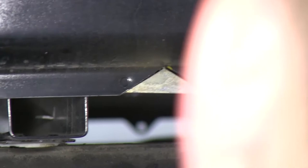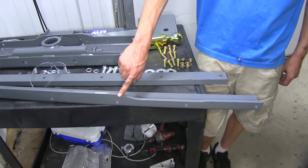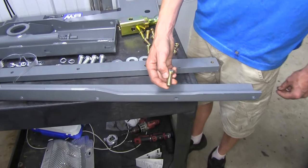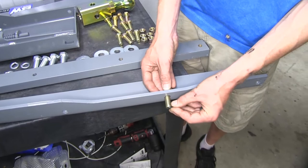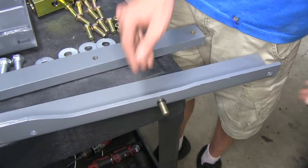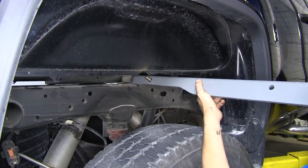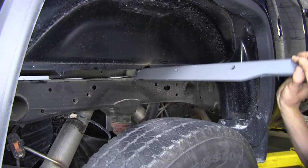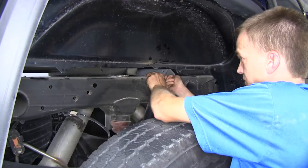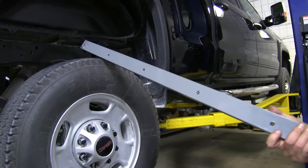This rail right here is our front rail. This section here, where we have a long segment where it comes down, is on our driver's side. At this second hole right here, we'll take one of our short half-inch bolts, stick it through the hole, and place this rubber O-ring over the bolt. This will keep it from falling off and making it difficult to insert this bolt over the fuel tank. With the bolt in place, we will now slide our rail into position over the frame through the notch that we made, and slide it to the front of the truck. Quick tech tip: before you install your rear rail, run the bolts in and out of the threads a couple times to help clean out the threads from the powder coating finish.